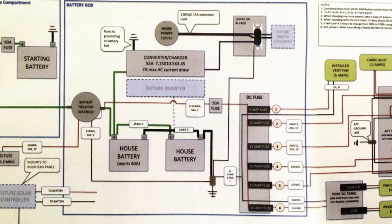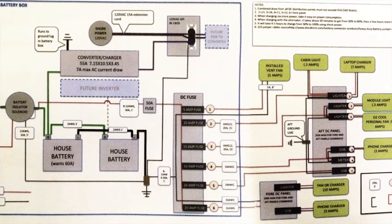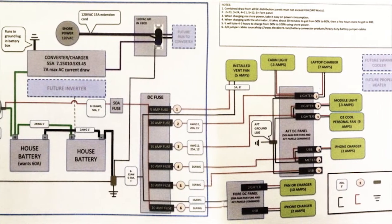After reading some horror stories from people who bought new RVs and started experiencing breathing problems and headaches, I thought it might be a good idea to look for materials that wouldn't outgas. 2 golf cart batteries power the living quarters and are recharged either by driving or by plugging into a household outlet. Designing the system took a little more time than I thought because, as it turns out, adding 120 volts to a metal vehicle is not something you want to do by trial and error.